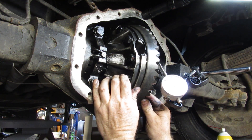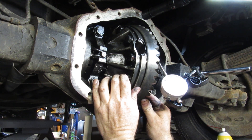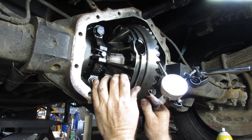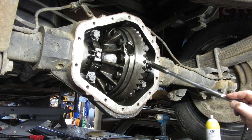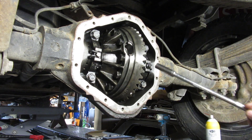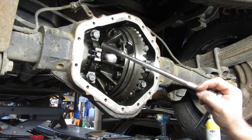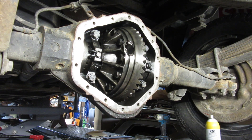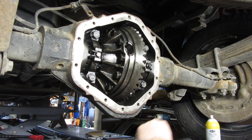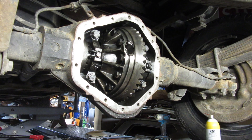I got this set up to check backlash and quite honestly we are on the high side of 12 thousandths, which is as far as you'd want to push one of these. I noticed there's a different bolt here than there — I'm assuming this is the original and this is Mr. Hackman's bolt. I'm going to see if I can find replacements or get a set of matching bolts ordered up.